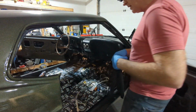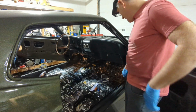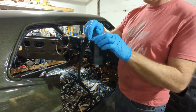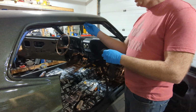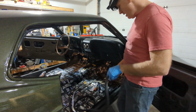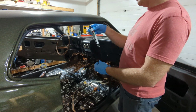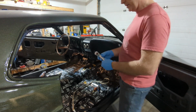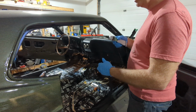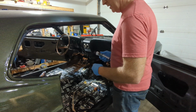Without you, sorry. Pretty straightforward. There's one screw that goes in the bottom screw hole there. You can see there's a little eyelet there that the screw goes in, and then this kind of pushes in to there, and yeah, glue it in place. It does recommend to use this 3M super black weather strip and gasket adhesive. It works really well. It dries quick. You put it on both sides, like any rubber cement. You wait till it tacks up, which happens in like 2 to 3 minutes. And yeah, stick it on.